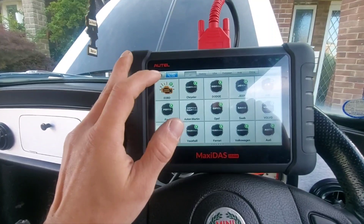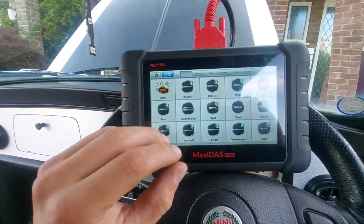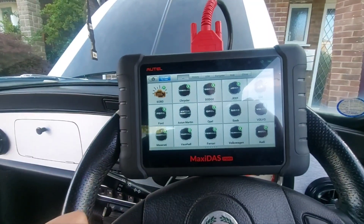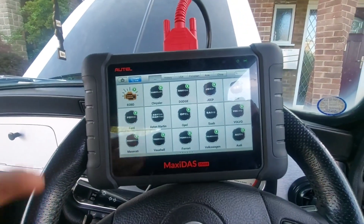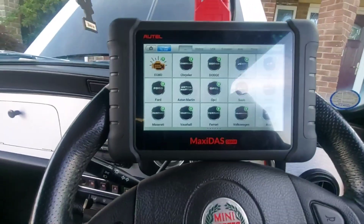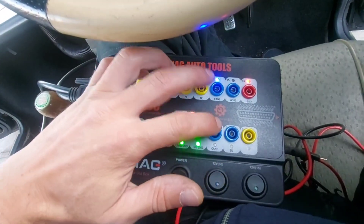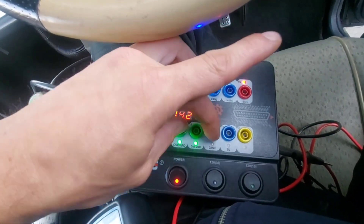On the auto VIN check and the emergency check engine system, which runs through all the basic protocols to see if it can connect in any way to the ECU, it could not. I put the chassis number in and it couldn't identify it. I was pretty sure it was going to be a failed ECU, especially because the throttle wasn't linked — it was getting a false signal from the throttle position sensor. I broke out the breakout box just to do a CAN high / CAN low test, but there's no resistance between those pins.